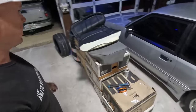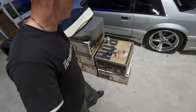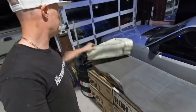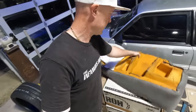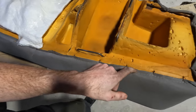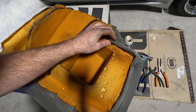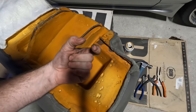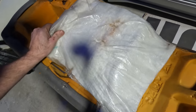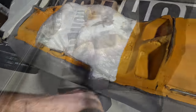I've got a couple of tools — some needle nose pliers, some side cutters. Nothing too fancy. The reality is you'd really want to have hog ring pliers. If you guys aren't familiar with what a hog ring is, well, I'll show you. It's these little guys right here. They almost look like a wrapped-over industrial staple, and in fact that's really all they are. I'm assuming they have the term 'hog ring' because it's sort of like that ring you'd see in cartoon pictures of a nose being pierced. Anyway, we're going to remove these guys from the seat and see how we get the fabric cover on. Let's get at it, starting in the back corner.